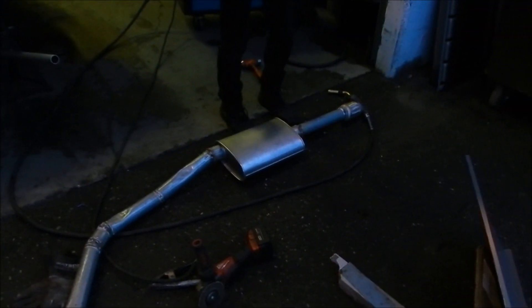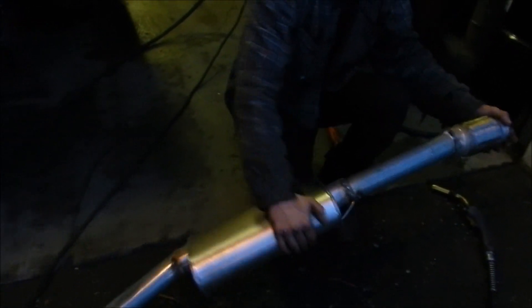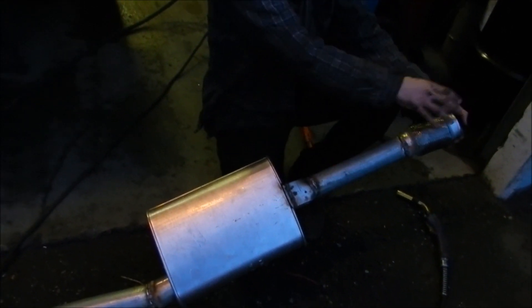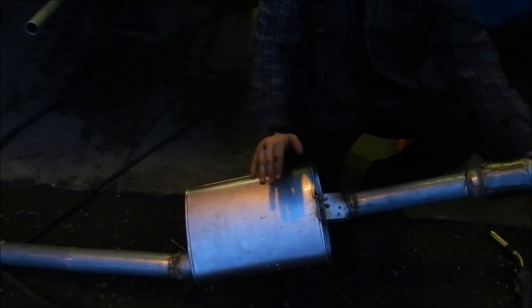Here's the pipe that Aaron's making for his car. The best thing you can do for a lowered car on your exhaust - this is the front side of my exhaust, technically we're looking at the top side that'll be up against the car. I always put a plate on this flange here because when you're driving you drag it and you catch right there and it'll rip everything off on you. It's like a skid plate more or less for the exhaust - it'll lift this up, and worse comes to worse you get high centered on your muffler. It's so bad to catch this edge coming into a driveway. This is a Nissan chassis thing I'm used to doing but we're gonna try it out on the Volvo.